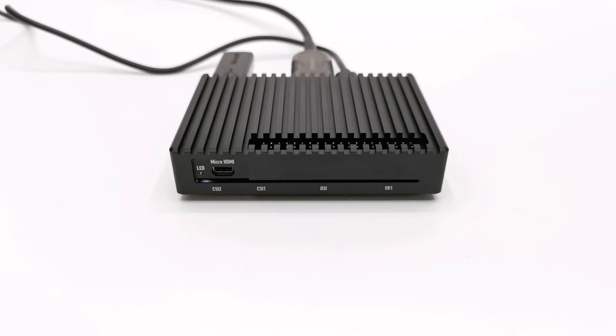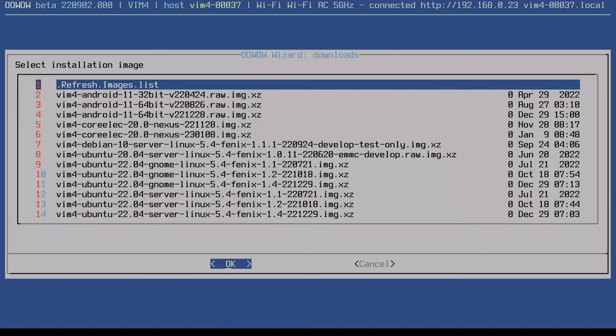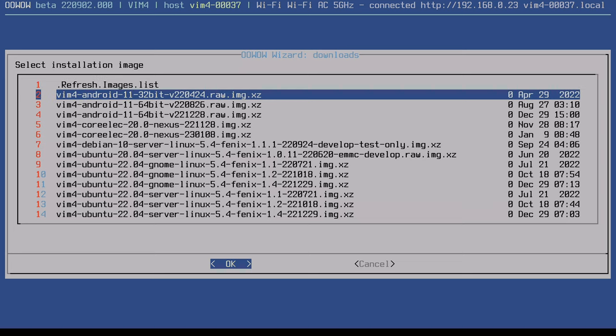So now that it's ready and equipped to sit next to your TV or monitor to assume the role of an Android TV box, it's not yet quite ready to perform that function given the cons in my first video. In my first video, its firmware was only available in 32-bit mode. It had no root access. It had no Google Play Store or Google Play services, no screen mirroring function due to the lack of Play services. It could not play any 4K HDR videos or surround sound audio due to a decoder issue.